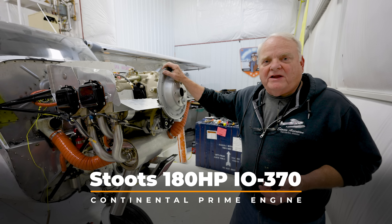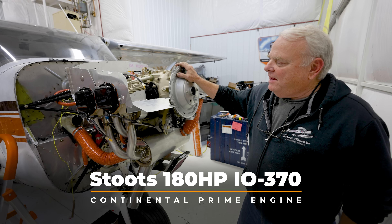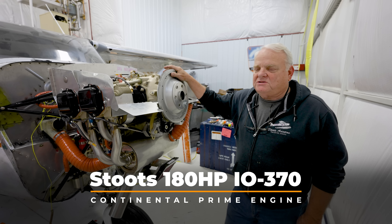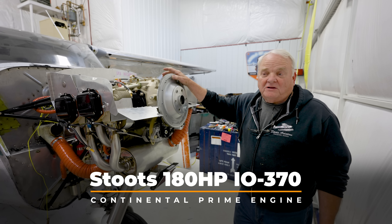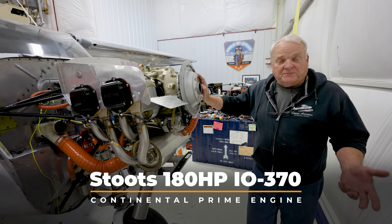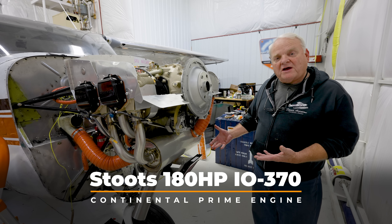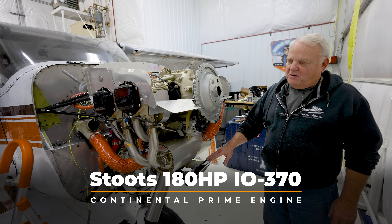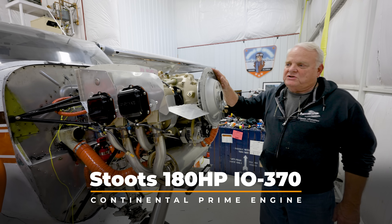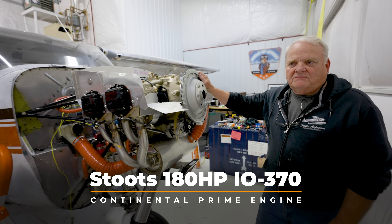It's an IO370, 180 horsepower rated engine, solid crankshaft, fixed pitch only, but it does have fuel injection and a roller cam in it. I think it's going to be a great engine for the older Cessnas that are used to fixed pitch and don't want to go with the extra expense and a little extra weight. This one is going to fit the gap to replace the O-300s now that they're obsolete and you can't find parts. We're going to introduce this to the market — this is a prototype build. We're doing various upgrades to the airboxes to get them to fit. This is a fuel injected engine but doesn't require a header tank — I've engineered that out of it. I'm anxious to see what it's going to do with his flight training and this airframe.